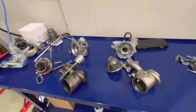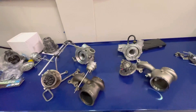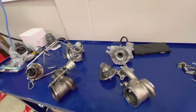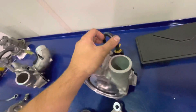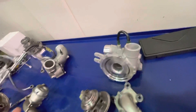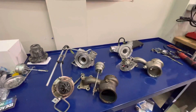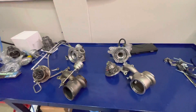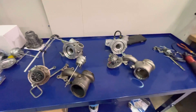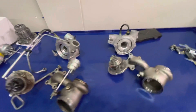If you're looking for 300 wheel horsepower out of the Focus ST, this is more easily achievable than with the stock turbo. This is a really nice bolt-on upgrade that matches OEM hardware — it comes with the wastegate control solenoid, the three-port solenoid, so it's a really nice package. If your turbo is blown or you're looking for that extra 10 percent, this isn't just for the Focus ST — it covers pretty much all the 2.0L EcoBoost motors using this single exhaust port configuration: Fusion, Escape, and others. It's built with OEM-level quality, as Garrett is an OEM supplier for a number of vehicles.